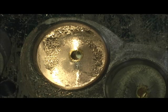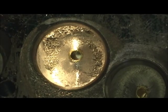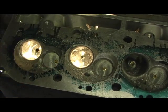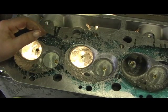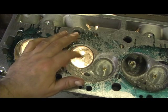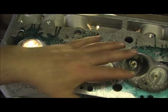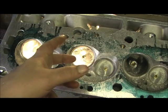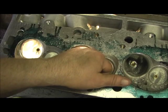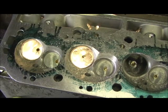They have a lot of finishing work that needs to be done, but it is a good design. They really did a great job on the transition of the port, trying to angle it as high as they possibly could without going to a majorly different degree on the cylinder head. I'm going to finish the rest of the bowls — the exhaust are all done, I've got six more intakes. When I get that done, we're going to turn the head around to the other side and I'm going to let you see how I take the ditch that I dug past the bottom of the guide and pull it out and blend it into the roof of the runner.